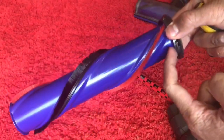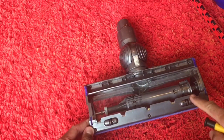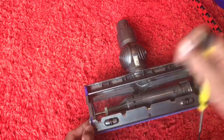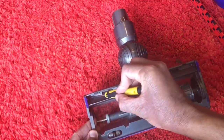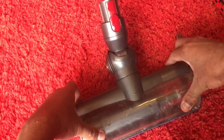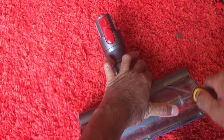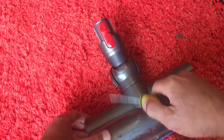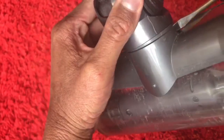Remove the following screws — there are eight of them. Three at the front, one here, here, and here. There's one more on the side, then two on either side, and two more here. With all eight screws removed from underneath, this part should lift out. It is a bit of a fiddle, but if you get your flat screwdriver and lift up from underneath it will unclip, then slide up from here and give it a bit of a guide.